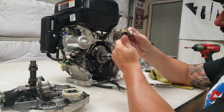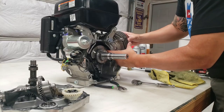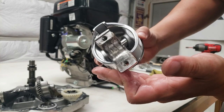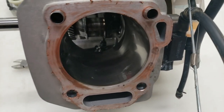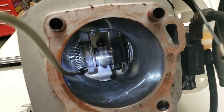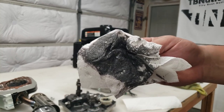See if I can get this out. Yeah, that is bad — that is not good at all. The bearing surface of the rod is absolute toast. The piston seems to be okay, the rings seem to be okay. Cylinder bore doesn't look terrible — I don't see any scoring or anything on it, and it is well lubricated. But that crankshaft is not looking pretty. We'll have to pull it out and take a look. That is all of the rod — just bits and pieces of it.